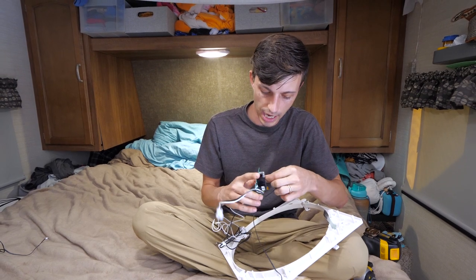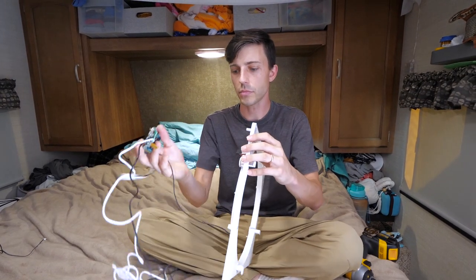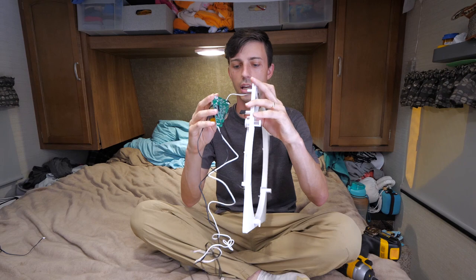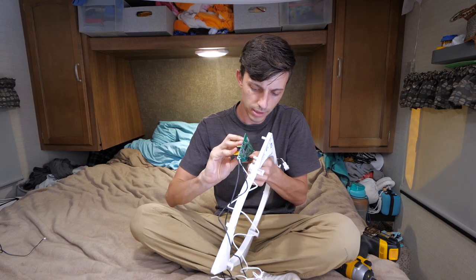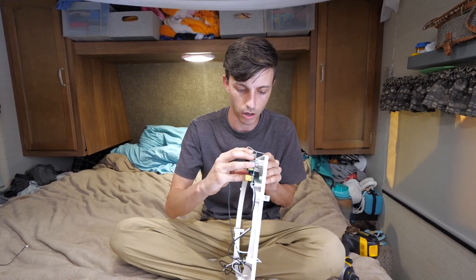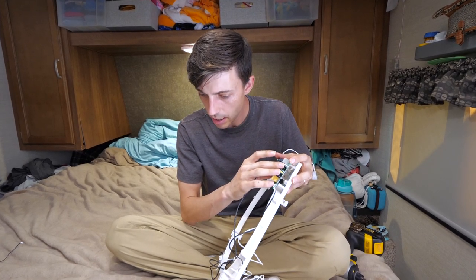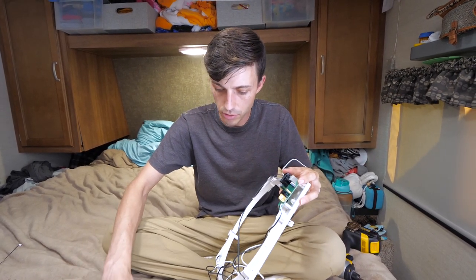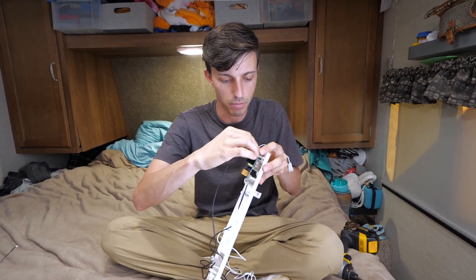So the new circuit board, I'm gonna go ahead and plug that temperature sensor in right there. And then we can plug the new button pad into our new control board. Now we're ready to mount our control board back onto this plastic bezel. And I've got those three screws right next to me. And they each came with a little plastic washer. And that goes between the head of the screw and the control board, just to protect the control board from those metal screws.